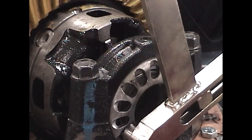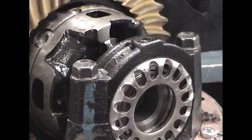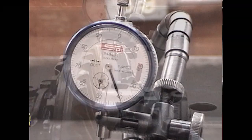Take a note of where you're at and turn the adjuster to the tightening position. This should be relatively difficult to do. Now, get the dial indicator out and re-check your backlash. You should be much closer to specifications.